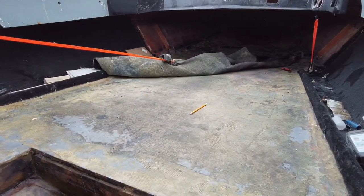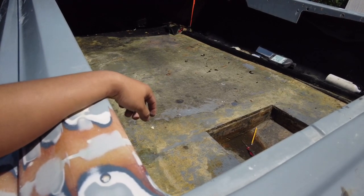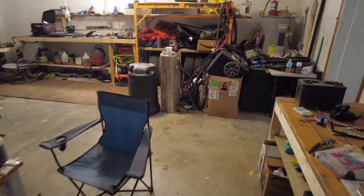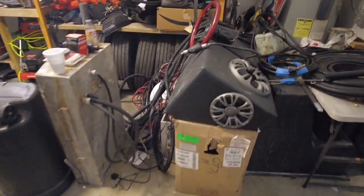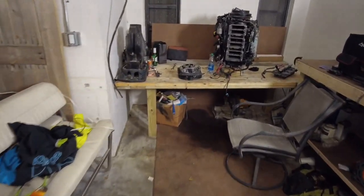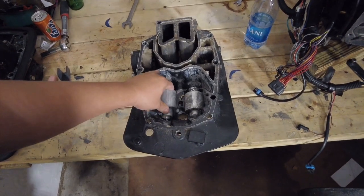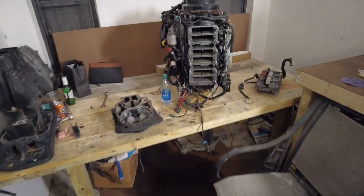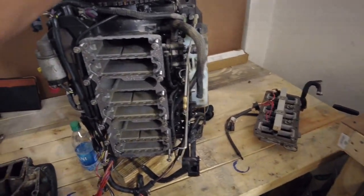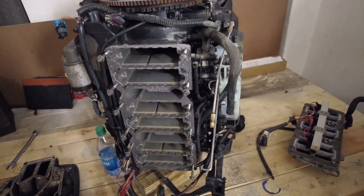I decided to rip off the carpet because I had some defects, and since the carpet's out I'm gonna pour foam into the empty cavities under the floor and get everything ready for spring. All I need to do is paint and put my accessories back on. I have my engine in pieces but it should be pretty quick. I had to take the power head off because the upper motor mount housing was cracked and my motor mounts were wiggling back and forth. This is my 250 EFI power head — I'm cleaning the injectors, installing some Chris Carson reeds, changing the fuel pump, changing the fuel regulator, and just servicing everything I can.